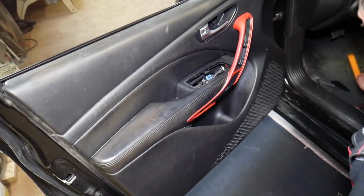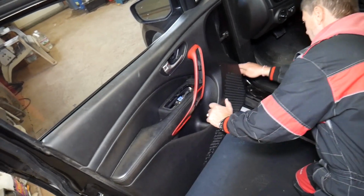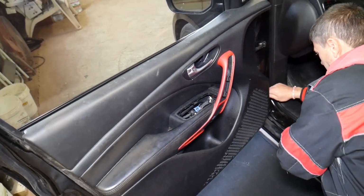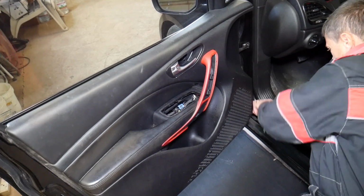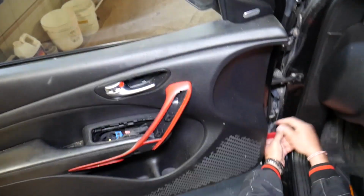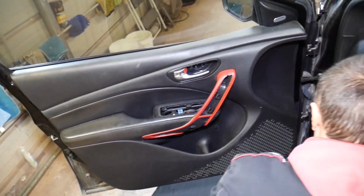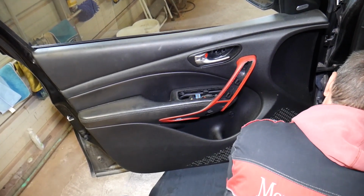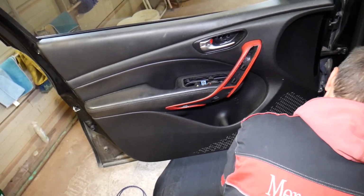Perfect. Now, we get a plastic panel removal tool. We should have only the clips holding that in place. So what we are going to do, actually, we're going to get it between the door panel and the door itself. And you need to pry. Okay, perfect. Now, if any of the clips break, it could happen, guys, especially if they're super tight, or sometimes if they're old, the plastic will be more fragile. We'll have the link in the description of the video below to see where you can buy new ones from.